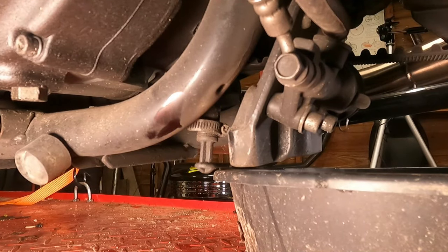The first thing you're going to want to do is start the bike up. That is because the Harley Sportsters have a dry sump oil system and the oil tank is underneath the seat. When the bike sits, all the oil will drain down into the bottom of the engine case. So when you try to drain the oil out, you won't actually get it all out. You need to start the bike, let it run for a few seconds, wait until the oil is circulating around inside the tank — you can take the cap off and look down in there and see this. Then turn the bike off, and then you're ready to start changing the oil.